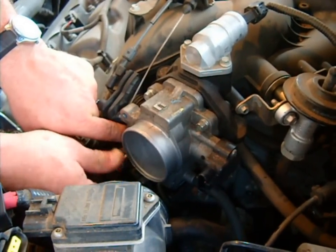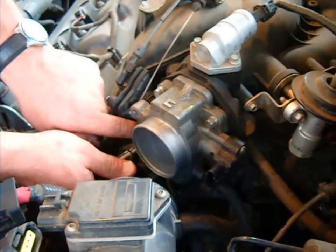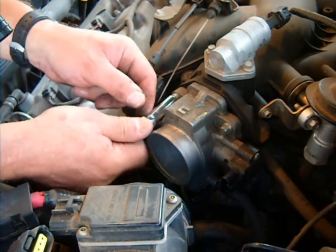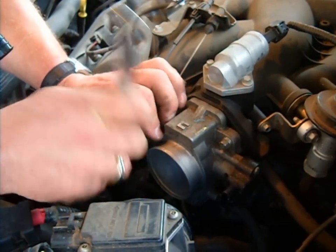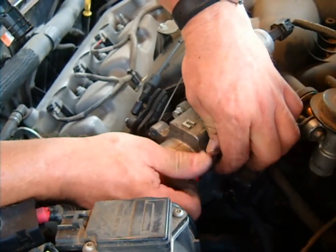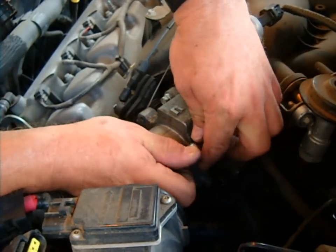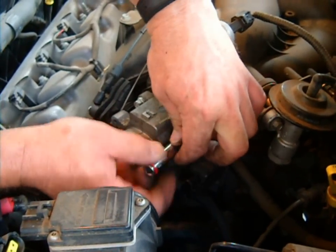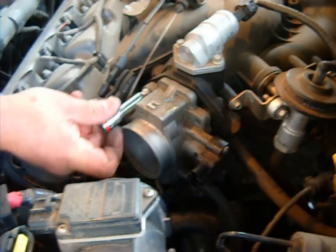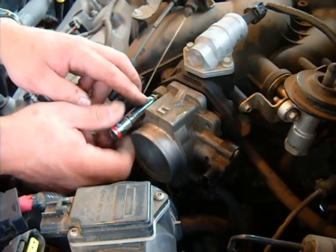Hot, hot, hot. Because what we do — since I take the five gas analysis, the five gas samplings on these vehicles when they come to me, I expect them to be hot and I jump right on them so I can get an accurate emissions analysis of the engine while it's warmed up, so we don't have to wait until the catalytic converter heats up. The catalytic converter has to be hot in order to burn the waste fuel, which is what we're trying to eliminate. It doesn't change much except the length of time it takes to burn your fuel, and that makes a huge difference in your fuel economy.